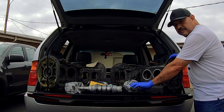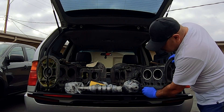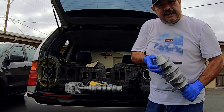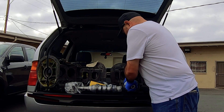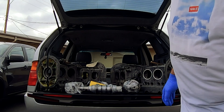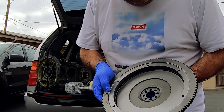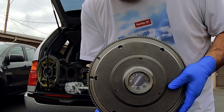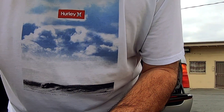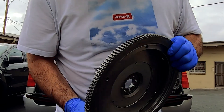I just got back my cranks and some flywheels. This one is a counterweighted crank that is 20-20 over. It's been doweled — eight dowels. For the Super 1600 build, I have two brand new resurfaced flywheels that are eight dowels, just out of the machine shop. They're both 12 pounds. The machinist told me to keep an eye on these and not let them get scratched or dirty on the mating surface.